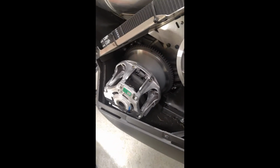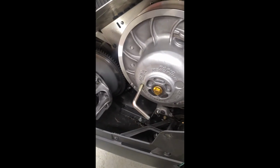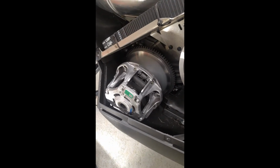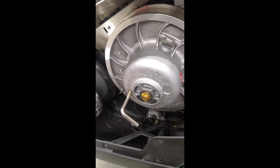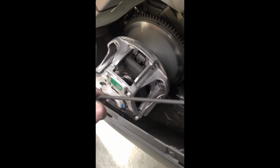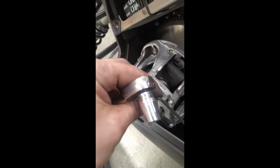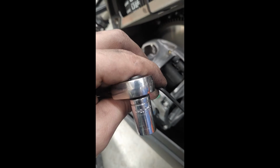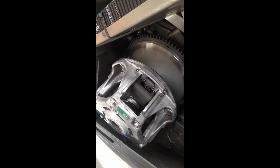So, switching out the weights on your sled. This is for any of the team clutches, 16 and up I believe. They're all the same, but you'll need to pull your belt. So you'll need your belt tool, and the Allen head side is 1/8 and the nut side is a 10 mil. Ratchet, wrench, whatever you can get on there, and that's all you'll need for that.